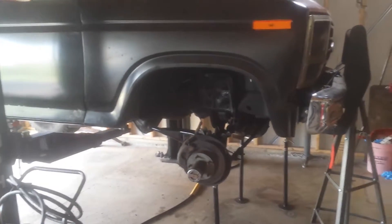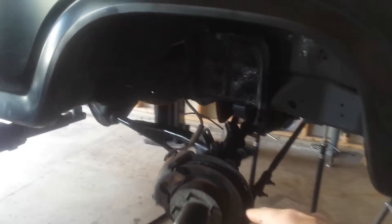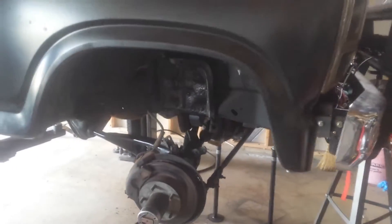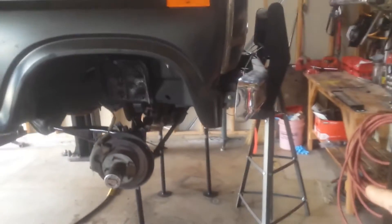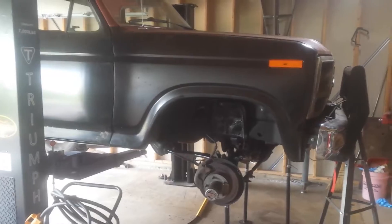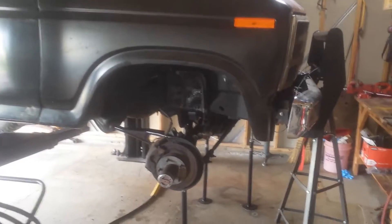What we've done is take the sway bar off, take the coil springs out, take the shocks off, and have everything hanging here. I've got it on the lift about three or four feet up. I plan on taking some ratchet straps for safety — strapping between the knuckle and the shock tower — then lifting the truck a little higher, putting some big jack stands underneath. That should give me enough sag and let me stand underneath and use the impact to get these bolts off the pivots.